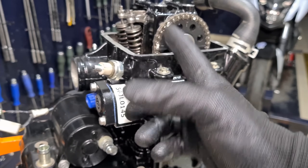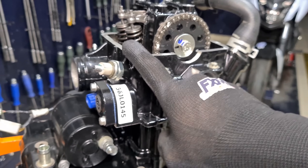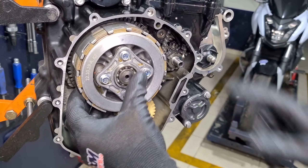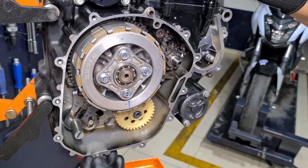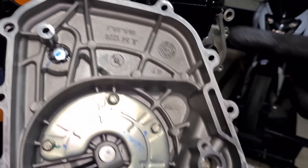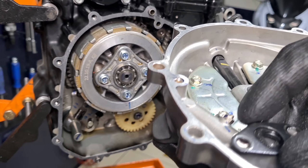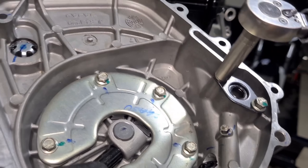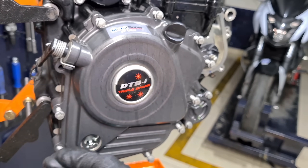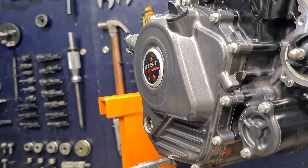The chain is now adjusted. Valve calibration remains — I won't do it in this video as I already have a dedicated video in the channel (link in the description and the card here). Now we install the clutch cover gasket and clutch casing. We install our bearing (already lubricated). Every time we lower the clutch cover, change this seal. If the casing surface is in good condition and the gasket is in good condition, no silicone is needed. We install the plate and the casing, always tightening in a cross pattern.